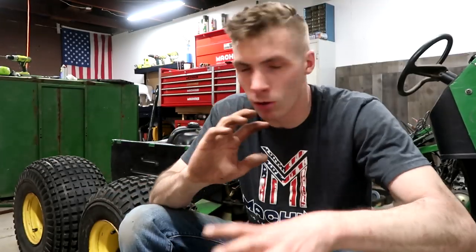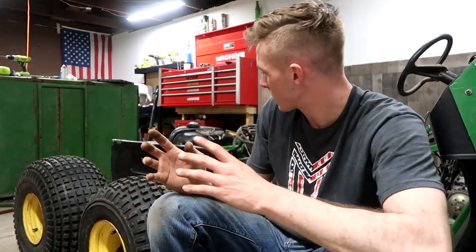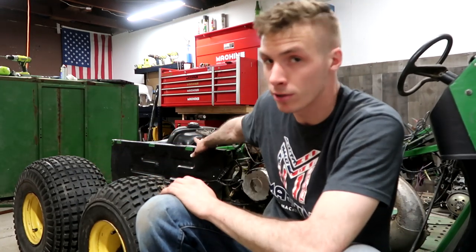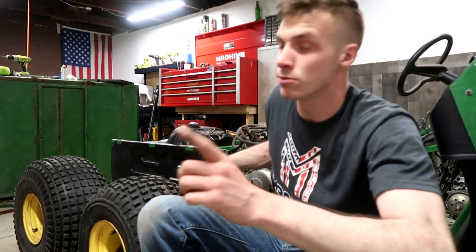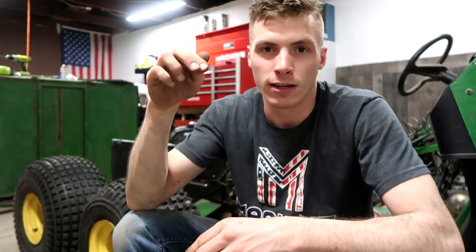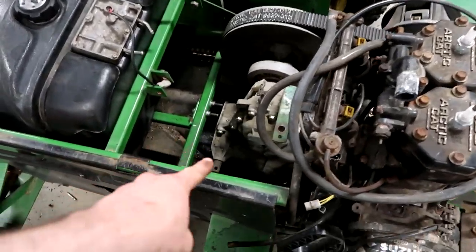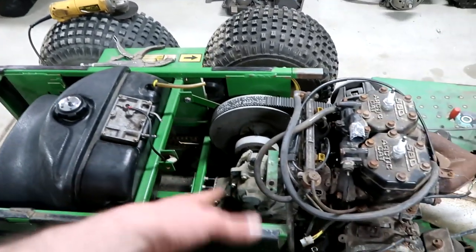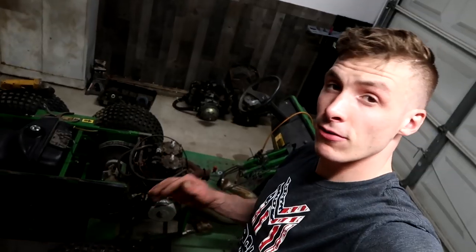Let's dig into the engine requirements. Basically what's got to happen is you need air, fuel, compression, and all that — the engine runs. We need air filters, those are on order. This is a two-stroke engine. Usually on a dirt bike or weed whacker you mix the oil into the gas tank, but on a snowmobile it's different — you put gas in separately, and oil goes into a different reservoir that mixes itself. If we don't have room for that reservoir, we'll just have to pre-mix it like a weed whacker.